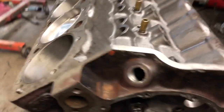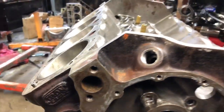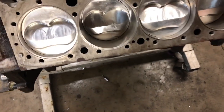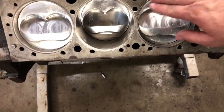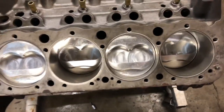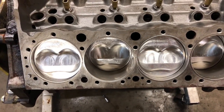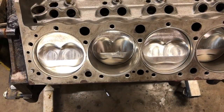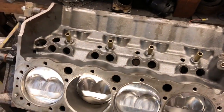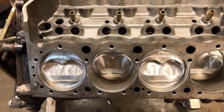All of the pistons are in the hole — I have an assembled short block, so I'm pretty excited. The o-ring kept popping out over here on this side. I think the groove has gotten bigger somehow. I'm going to need to get a little super glue or find a slightly bigger wire. It's stainless steel 0.041 wire, so I'll see if I can find a 0.045. They make a 0.051 but I'm not sure I can get that down in the hole. It's got copper gaskets so I need some type of retaining wire.